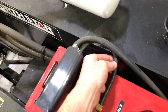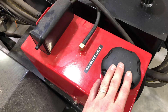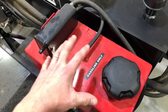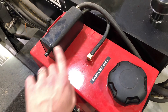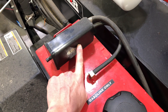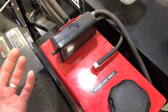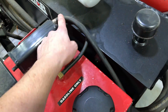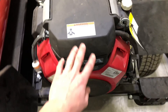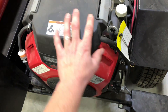Here's where it's connected to the fuel tank. When this fuel tank is sitting here, this is a positively closed fill cap. Right here is where it's going to vent. If this has got to breathe throughout the day — if it gets hot or cold — it can breathe both ways, but the VOCs are all getting captured by the charcoal inside. It's just black activated carbon. When you start the engine up, it pulls a vacuum on this one here, and it goes down over to the carburetor area. Right here is where it's pulling the vacuum — pulls it into the engine.